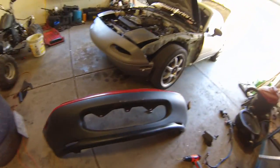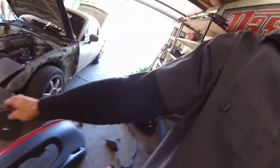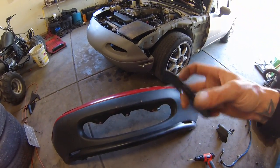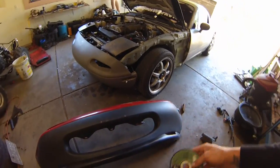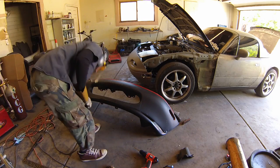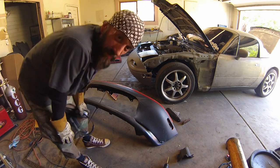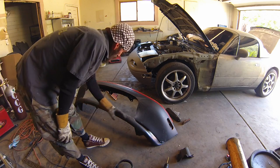We're going to cut that out and we should have our shape. If you've ever cut anything with a cutting wheel on metal, you know they send out a lot of sparks and will very easily damage your eyes and skin. If you're going to cut plastic, you want eye protection, hearing protection, and long sleeves because it's going to send off pieces of molten plastic. That molten plastic will actually stick to your skin and burn you really badly — so definitely wear protection. Also, this plastic is definitely chlorine-based because the fumes coming off of it are horrible, so you don't want to breathe that in.